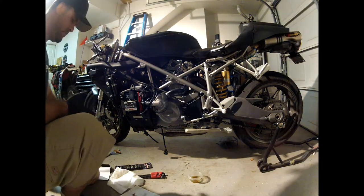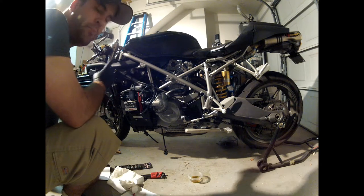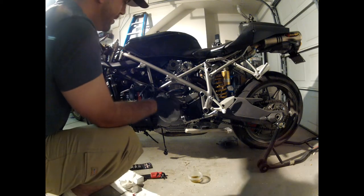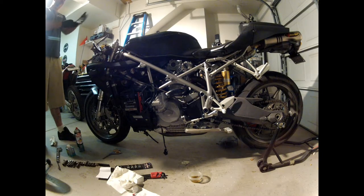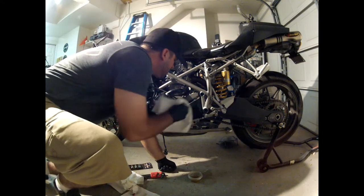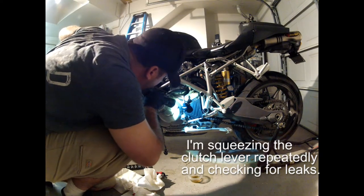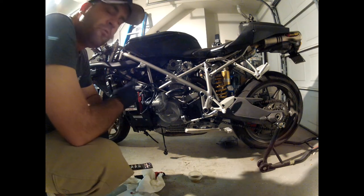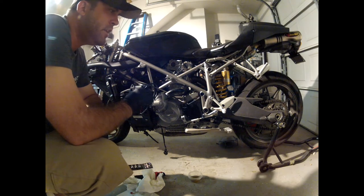And we're there. At this point I'm going to go ahead and clean those fittings up really well, put the dust cap back on, and put the cap back on the master cylinder. Over the course of the next couple of rides I'm going to take a careful look at this. Right now I'm going to pump it a few times to see if we have any leaks, but I'll clean it up before we do that. It would appear that we're sealed. All that's left is to do a little bit of cleanup, reinstall the cap on the master cylinder, and then come back and quantify the reduction in clutch pull force.